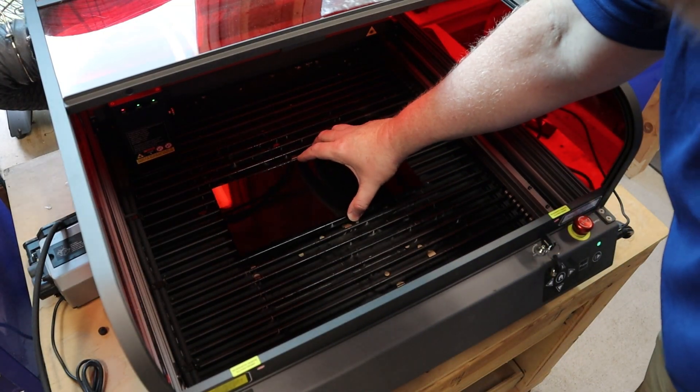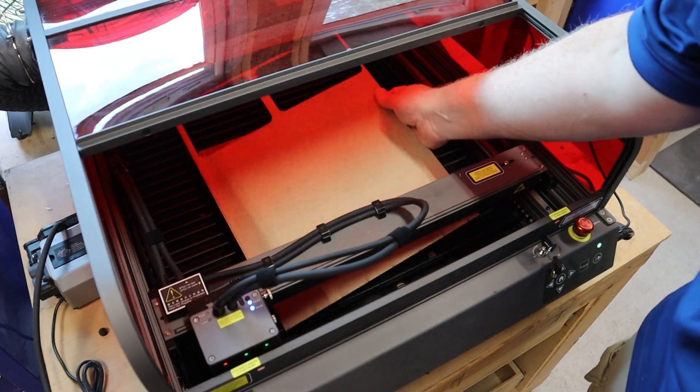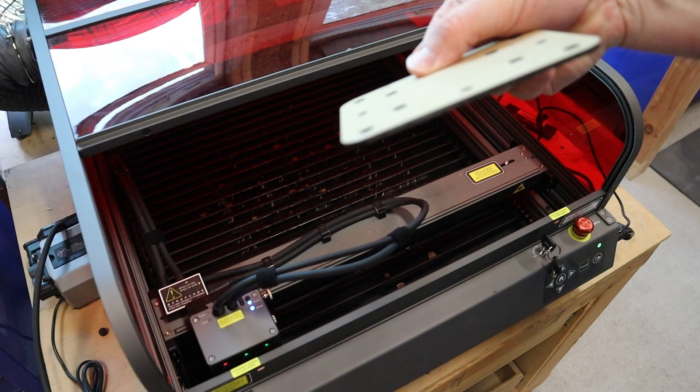I made several prototypes. In the final version I ended up cutting the base out of quarter inch acrylic, and then the top and bottom plates out of eighth inch material. You need that bottom plate to keep the screws from touching something that might be conductive, but you could build the entire project out of a single piece of eighth inch acrylic — you just have one more sandwich layer to glue together.